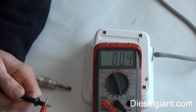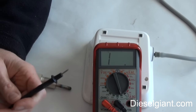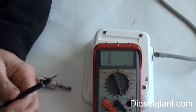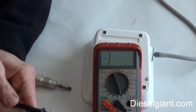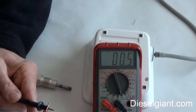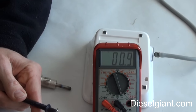It says 0.4 — that's 0.4 ohms of resistance. Anytime electrical energy is going through something, you're going to have some resistance, even if it's so minute your meter can't pick it up. So 0.4 to 0.5 ohms of resistance between these two probes is standard for this meter — your meter may read something a little different.